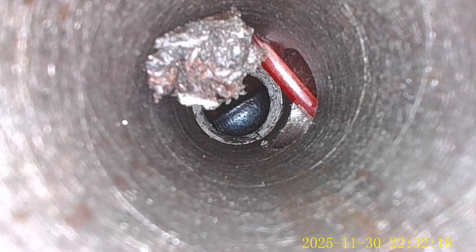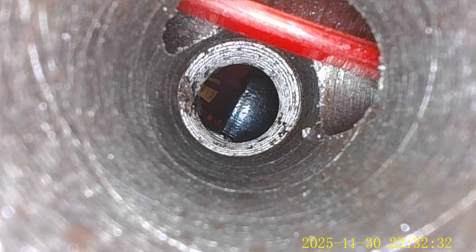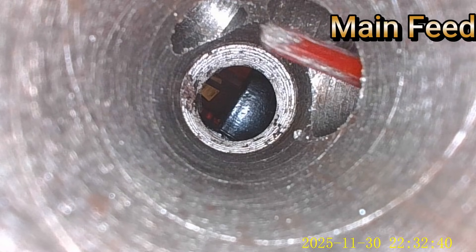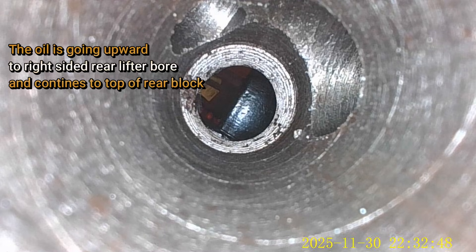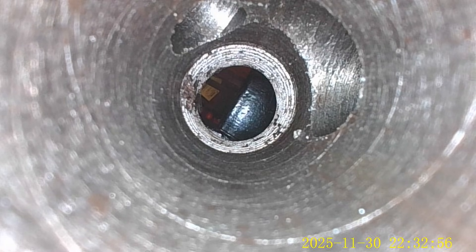They all feed the same, just like on a stock Cleveland. And if you keep going in the back — I'm going to push that right out on the floor so we can look at it. One of them is the main, which is coming from here. Now it's coming and feeding the main, and the oil keeps going up this way. That's where it's going to cross over in the top of the block to feed the other side — the left side lifter bore. You'll see how all that works.